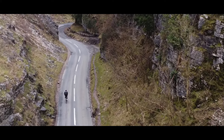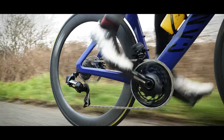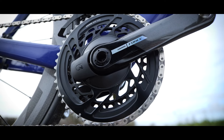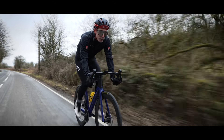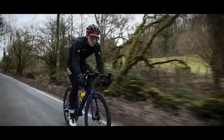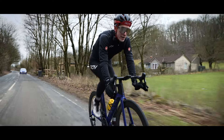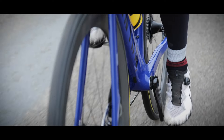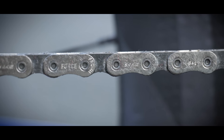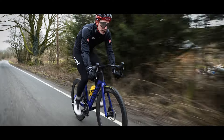In use, that shifting does feel really good. I did ask SRAM about the issue of replacement chainrings, because if one chainring wears out you can't replace it on its own — you have to replace both at the same time. That caused some controversy when Red launched in 2019, but four years on, SRAM says so few people have worn out their Red chainrings that just 0.7% have been replaced through premature wear. They claim their 12-speed groupset should last 50% longer than their 11-speed, with the flat top chain being a key reason — though mountain bikers also rave about 12-speed Eagle durability without a flat top chain, so there's clearly something else at work too.